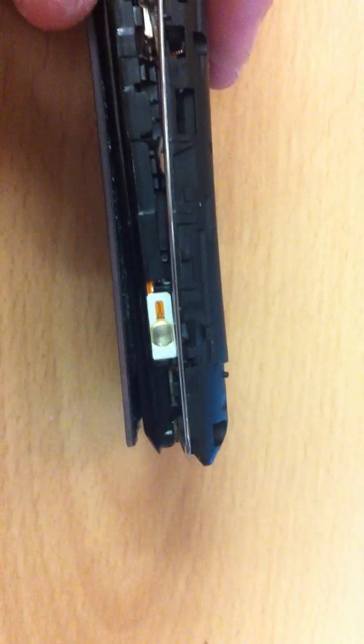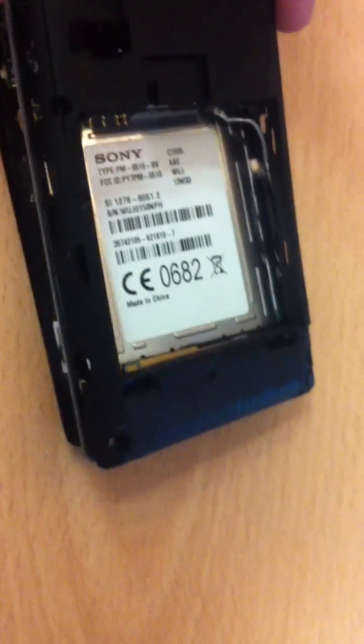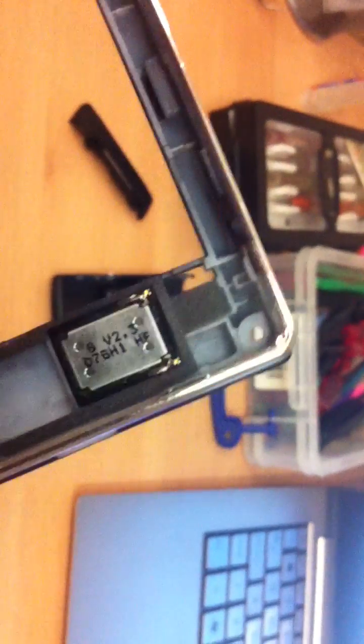Once you do that you're going to need to run a case opening tool, and you actually have to go above the bezel. You'll see the silver bezel — run a case opening tool around it and this is the whole bezel that actually comes off, so the front of the phone. This will be slightly overlapping at the bottom, but on this one it looks like it completely comes off.